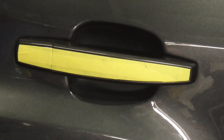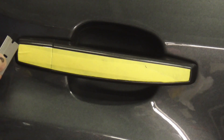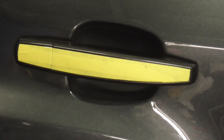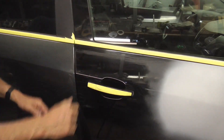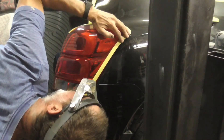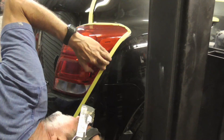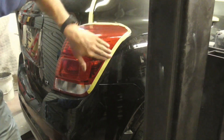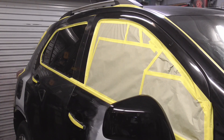Here's a close-up shot of the vehicle's handle. You can tape right along here — this is chrome in the middle — tape right along here, and then just cut it on the ends with a razor blade to get a nice clean line. Another handy tip is to mask it so you can always still open the doors. If you pull the tape pretty tight, you can go around curves like this tail light. After you outline everything with masking tape, you can then paper off any large areas.